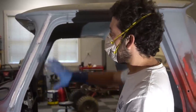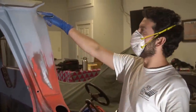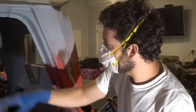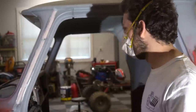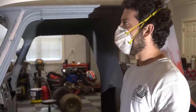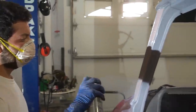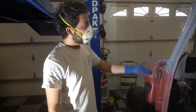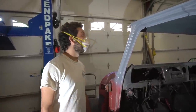I'm going to be ready for some more paint to kind of reset and see where I'm at. I know for a fact I'm going to need another round of body filler. The drip rail is a main area because there's a lot of pitting there. After the drip rails, these back sections here — and I have to redo my seam sealer, of course — and then the firewall. The sanding should go quickly and then I can just hit the whole thing with a high-build primer, really lay it on there so I have lots to work with for wet sanding. That's the third round of paint now. And as you can see it's getting better — it was like the surface of the moon before, it was so pitted. But slowly but surely, we're getting there.